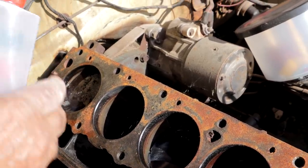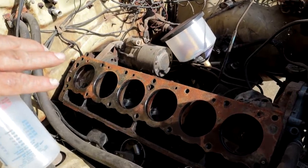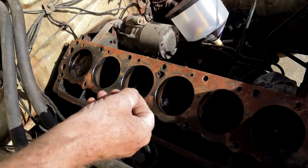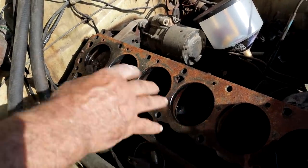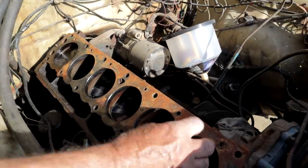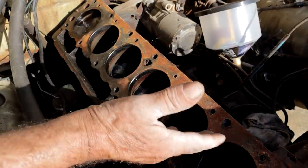Now we're just going to watch. If any of these are really bad, it's going to bleed down right away. Naturally, you have your ring gaps, and the oil ring does a fairly good job of sealing liquids, but there are still gaps there. If there was a real problem — where all of the rings were embedded in the piston, crusted up — this gas will pretty much run right through it as if there's a hole in it.